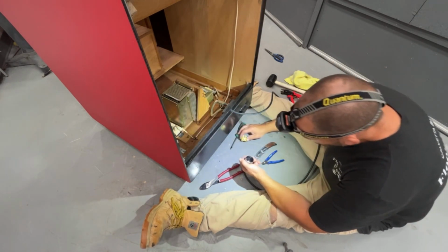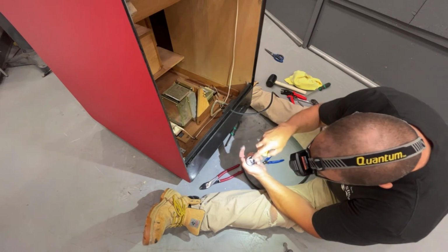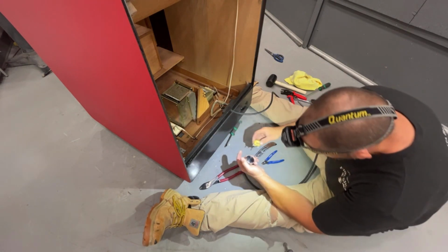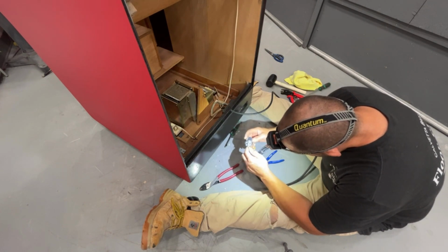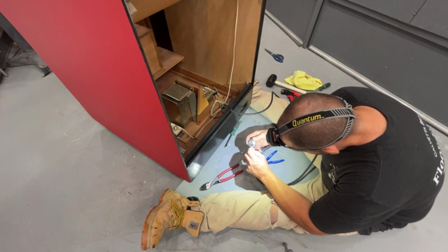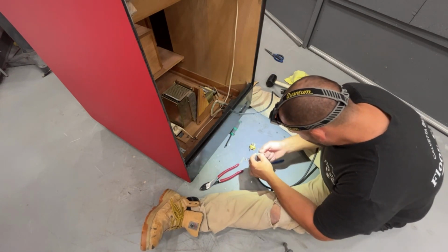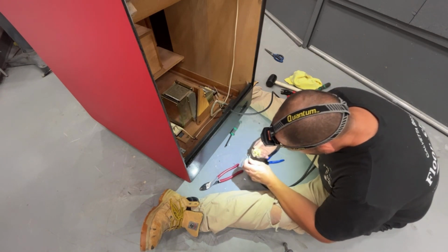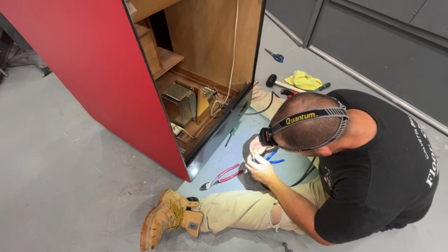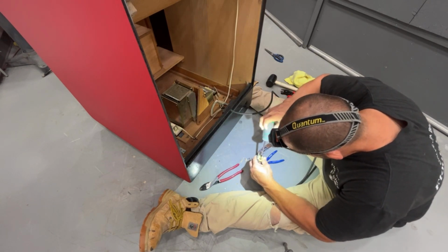And then you got to make sure when you put these plugs together that this brass piece hits that spring inside there. That's your grounding lug. So feed this through. Your silver screw is your white. Your gold screw is your black. And then obviously your green screw is your green wire.